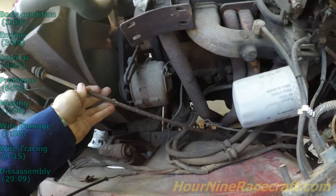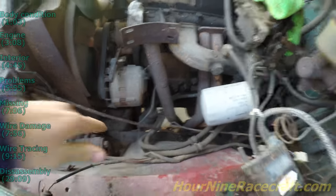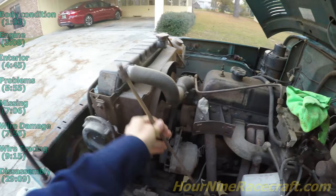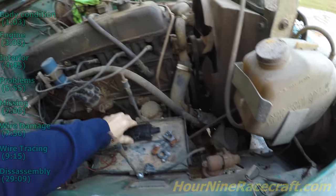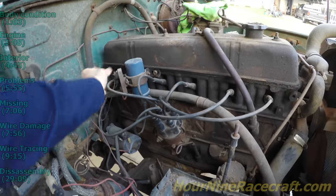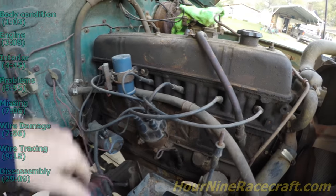This is part of the radiator support that goes in and bolts into that bracket — on the left side of the vehicle. There's one on this side as well — a radiator support that goes down to right in front of the bottom of the battery. This is the ignition coil, and that's what the ignition coil bolts to — the side of the head. The firing order on this is 1-5-3-6-2-4, considering it spins clockwise.